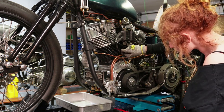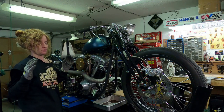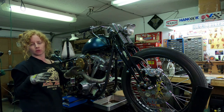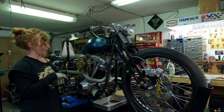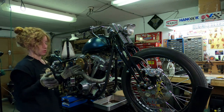None of these lines even have to be done up very tight with the soft seals in them - I don't have to do them up too tight at all. I'm not taking all my lines off, just my oil lines. I'll do my fuel and brake lines when the bike actually comes apart, because it's a pain trying to get all the lines off when the bike's together, and I don't need to replace any seals in the lines that don't get hot.